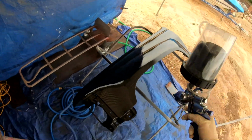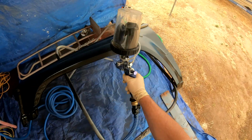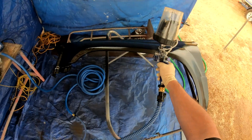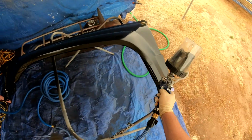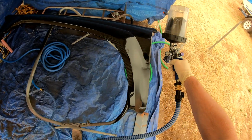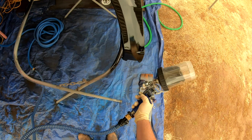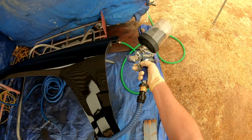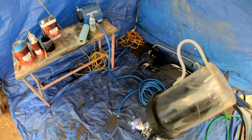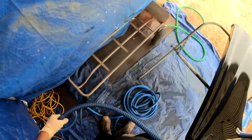It was like flat as glass, and it was as good as it was when I started with the fender before I messed it up. So I'm thankful I didn't have to put any filler or putty or any of that sort of stuff in any of the flaws. Just being able to bang it out, hammer and dolly it a little bit, and then lay in some heavy primer and block it out, wet sand it. It came out real nice.